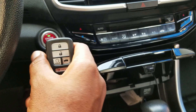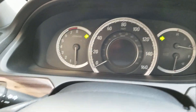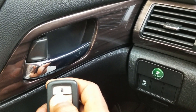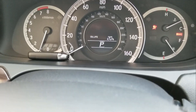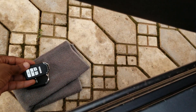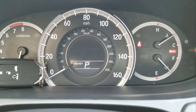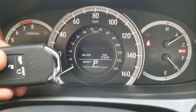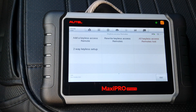Just to demonstrate — if I turn this off and go to the door, this is now going to work. You can see it's unlocking — unlock, unlock. So this key now works. The car starts right away. Now I'll take the programmed key out of the vehicle and bring in the previous key that was working — and you're going to see that this one is no longer programmed. You can see we're now getting the no-key alert, so that tells you this key is no longer programmed to the car. That's how you do all keyless access remotes lost on this 2017 Honda Accord. As I said, the procedure will work on other Hondas with smart entry. Like, share, and subscribe if you loved this — catch you on the next one, peace.